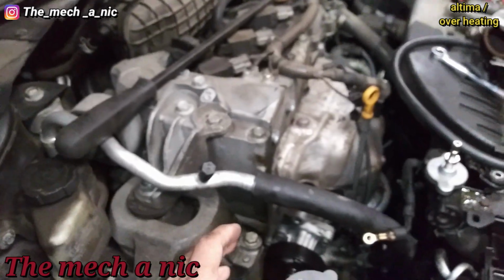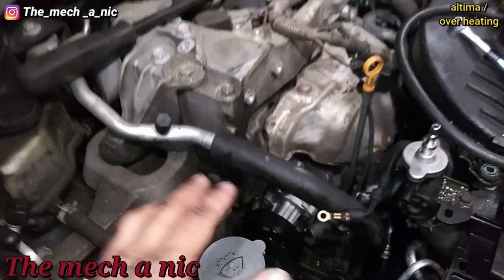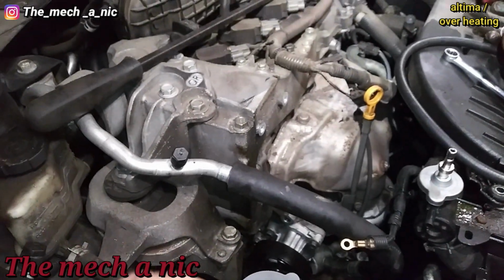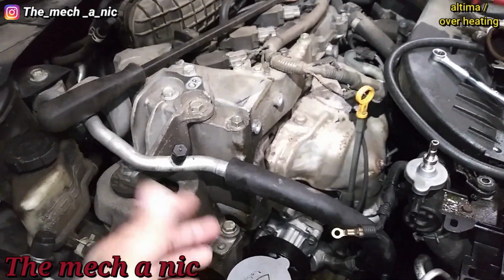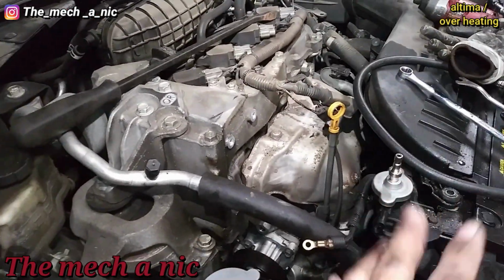That indicates you put way too much, and then it's going to make its way into the cooling system, and that's not good. So I'm pretty confident that this is now going to seal. Sometimes it's just minor imperfections in one of the surfaces, or let's just say the gasket isn't 100%, and you get tiny little leaks like that. It is what it is. It's not too bad of a job, but the important thing is you didn't put everything back together. That's where the pressure tester really comes in handy.